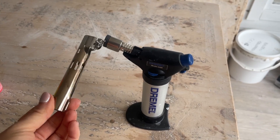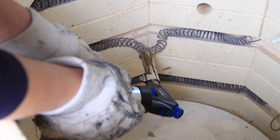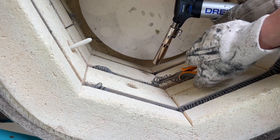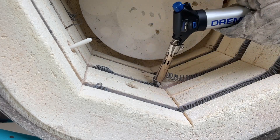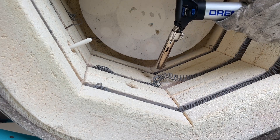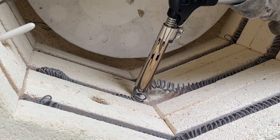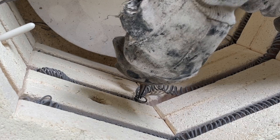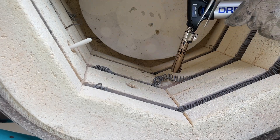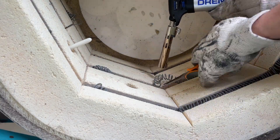This was the first time I've ever done this so it took a bit of fiddling about. At first I used the blowtorch with the extension attachment as the literature said it would make it hotter, but it took ages to get the elements hot. Taking it off worked much quicker. I held the blowtorch close to the elements and after about 20 to 30 seconds I tested the wire with my needle nose pliers to see if it had softened. If it bent relatively easily, I would gradually ease it back into place bit by bit. You need to keep heating the wire as it cools down really quickly and gets stiff again. Be quite patient and do this a small bit at a time — you don't want to risk snapping your elements.